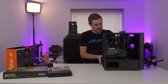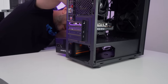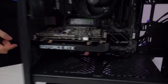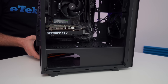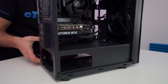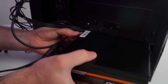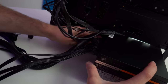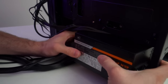We're going to try and slide this into the case, working around the cables already routed for the motherboard. You can see the cables down here are routed quite nicely, but I want to get the power supply in and work around that. We do have to be careful of the hard drive positioned where it is. When you put a power supply into a case, you'll find it kind of goes in but then sits back, giving us more room once it's in place. You will notice we are putting the power supply in with the fan facing downwards — I'll show you exactly why that is in a second.